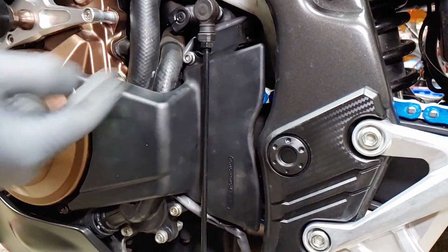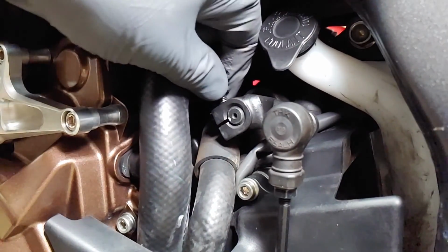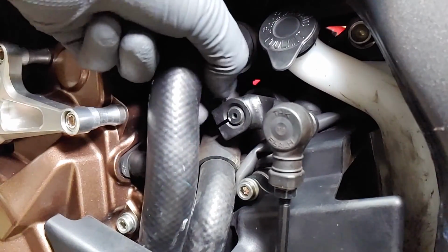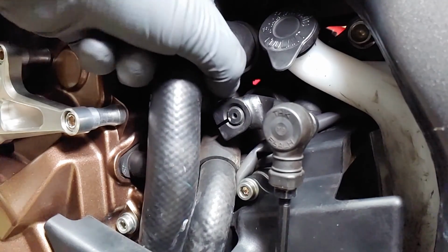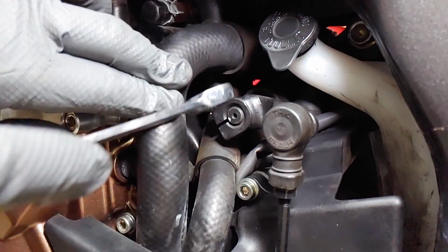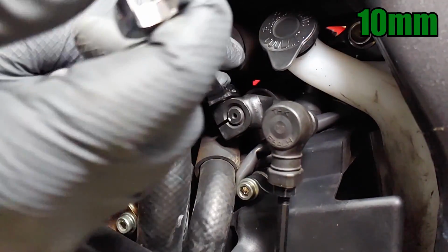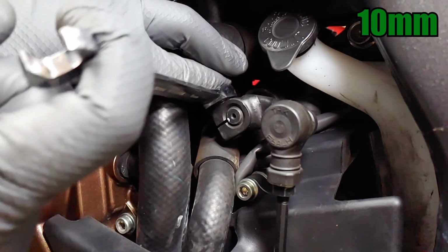Since I ordered a bigger sprocket for the rear, I used an online chain length calculator to figure out how long my chain should be, but the chain I ordered turned out to be too long because they didn't count the master link in the total chain length, which is really stupid. I should have checked the chain slack before securing the master link, and because I didn't, I had to order a new master link for $22.45 and wait a week for it to arrive. At least the chain wasn't one link too short, or it would have been a much more expensive mistake.